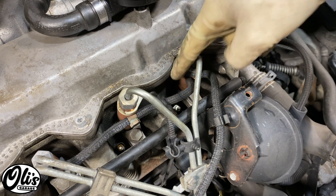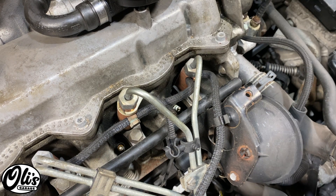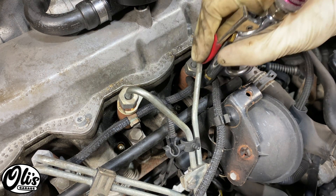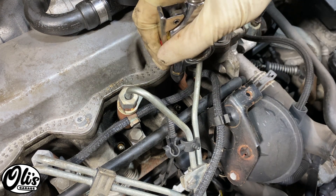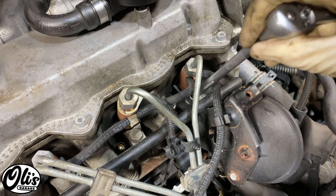Make sure that you clean away all the debris that's sitting down here. If there's quite a bit, it's just hard to see on the camera. For that I just like to use compressed air. Grab yourself a 10 millimeter deep well and crack it loose.